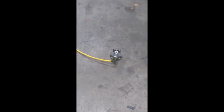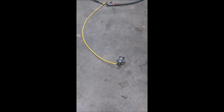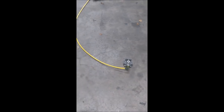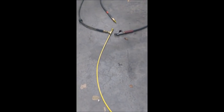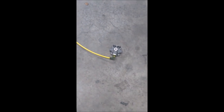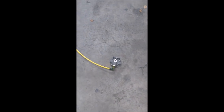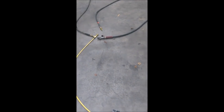Same setup, but this is without worrying about the air suspension — in a situation where you're just trying to get it out of the road or get it back to the yard. You would just tie your plastic line into your T, come back to the quick release valve, unplug the airline supplied from the truck, and supply your line to it. Release your truck brakes — truck and trailer are both released. You can get it out of the road.